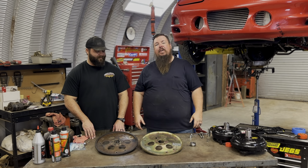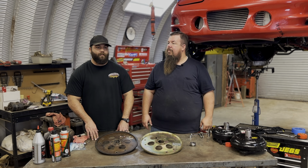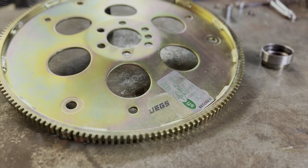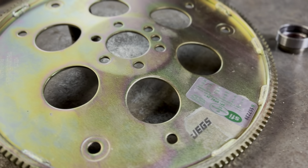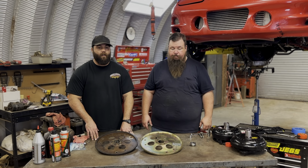So you want to tell us something about your flex plate and why you're running it? Yeah, so I decided to upgrade the flex plate while we're swapping out the torque converter. I get the budget deal — most of the stuff on this car was budget based. But as we crank those horsepower numbers up, we want to make sure that we're being safe while doing it. These stock flex plates are cheap; you can get them at a junkyard or wherever. But I definitely recommend if you're making any kind of real power, go to an SFI flex plate. It's just a good idea. One of these may fail, and if something like this comes apart, you could injure yourself or somebody outside your car. So I definitely recommend making that upgrade. And for less than a hundred bucks, it can be done — these things are affordable and reasonably priced.